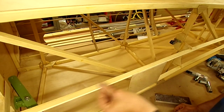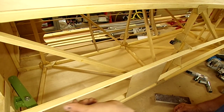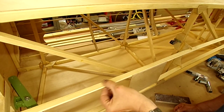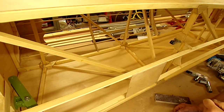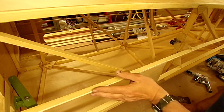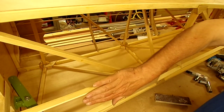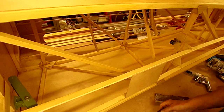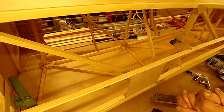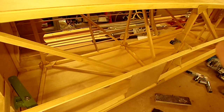I'll be putting a coat of varnish on those again. The stringers were originally coated, but the whole stringer will get a second coat — single coat on the edge, double coat on the side — to protect everything. Just before covering, I'll do a very light sand to make sure it's dead smooth, and the covering won't be bonded to the stringers so it'll ride across without wearing out. No tapes and no bonding for the Oratex 600 on this aircraft.